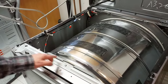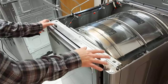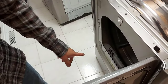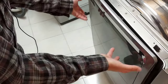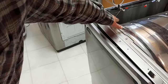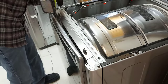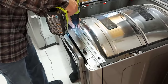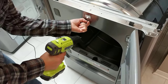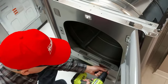You're going to need a Phillips screwdriver for these three screws here and there's a screw here too. There may be some other screws on yours — this one is missing a couple. Whatever screws hold the front face of your dryer in place, you need to undo them, and there are some inside as well. I think it's this one here and then two down at the bottom, then the whole front piece will fall forward, clips at the bottom, and you just lift it up. I'm going to use my Ryobi gun to save time. These two here definitely have to come out.